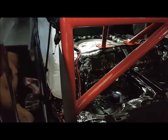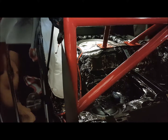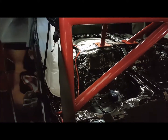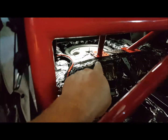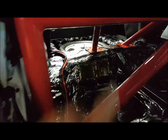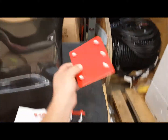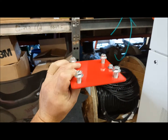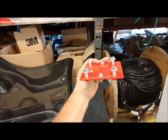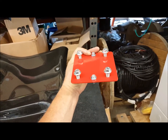On the back side, the plates go underneath the chassis of the body, where the axle goes, and then you drill the holes, put the plates underneath. There's 2 bolt holes on top. As you can see, the center holes for the kicker plates are much larger. What ends up happening is these bolts would be the bottom side of the bracket underneath the car, and the 2 top holes, the center, hold it in place, while the 4 bolt holes hold the actual stiffener arm.